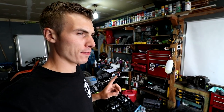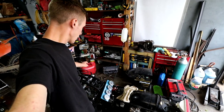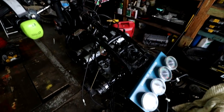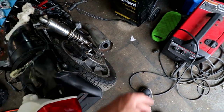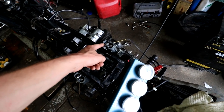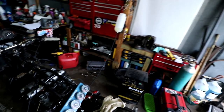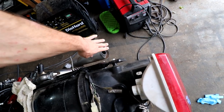I've probably been at this for about 5 hours now and I've got the low adjustment settled out, I believe. However, when I give it some gas, some cylinders backfire out of the exhaust and some backfire out of the carburetor — you'll actually feel or hear air coming out of the carbs or exhaust. I've narrowed that down to cylinders 1 and 3 coming out of the carb, and then 2 and 4 coming out of the exhaust, or at least maybe number 2 or 4 or both. I can't just put my hand in front of carburetor 1 and 2 and confirm the backfire easily.